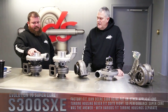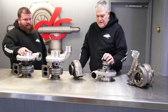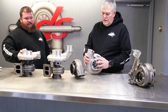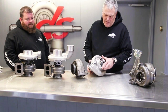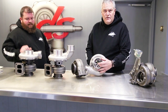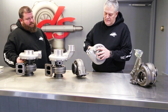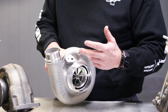As you said, this was an OE production turbo used in a lot of high-performance applications, whether it be pulling, drag racing, or street racing. And it evolved into this from the Borg Warner EFR turbo line. They've taken their compressor wheel aero and put it into the S300 line in a journal bearing turbo, where the EFR is a ball bearing with a different material turbine wheel and everything else. When they enhanced this with the SXE line, they went to a billet compressor wheel — machined from solid — and changed the design of the compressor housing, as you can see, to include a boost port and a speed sensor port if you'd like.